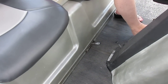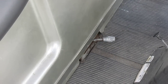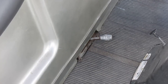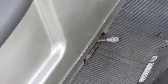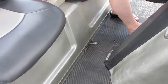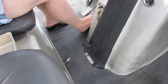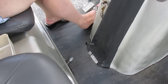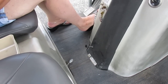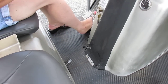Right there is a shift lever that goes between forward and reverse. All that basically does is change the polarity of the start motor. Being a two-cycle engine, it just cranks and starts — runs in reverse or forward depending on which way you want to go. Down there by the floor is the choke; pull that out to richen the mixture in the mornings when it's cool.